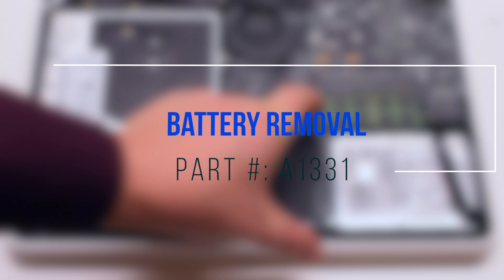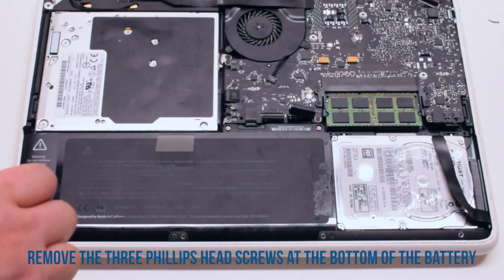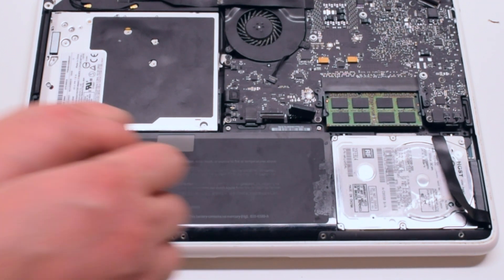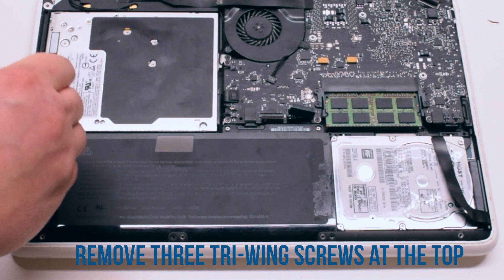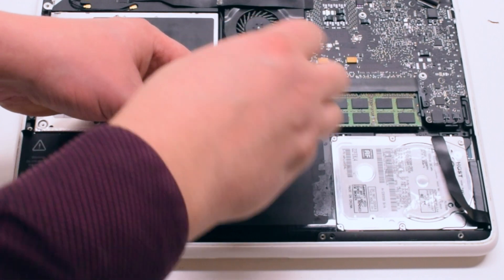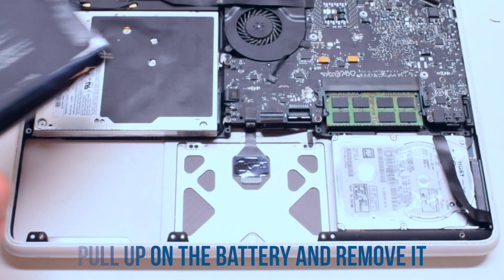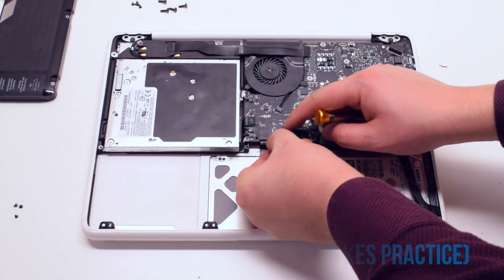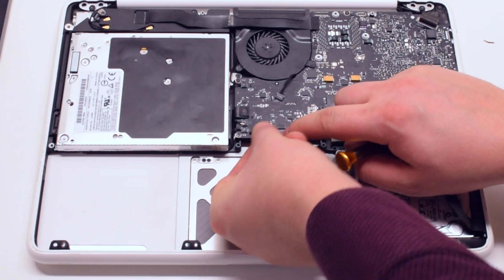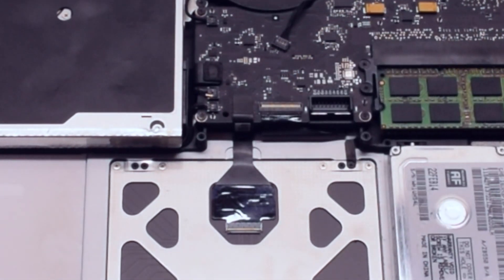We have to remove the battery to reconnect the keyboard. Battery removal: start off by removing the three Phillips head screws at the bottom of the battery, then remove the three tri-wing screws at the top — the one on the far left is hidden behind a piece of tape. Pull up on the battery and remove it. Now that the battery has been removed, we have access to reconnect the keyboard. This is a difficult task and might take some practice. Make sure the latch is lifted up before tucking in the keyboard cable, then press down on the latch.